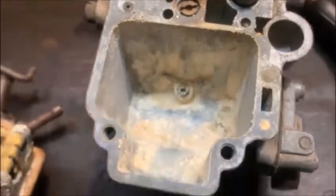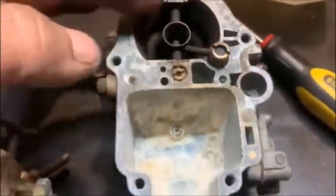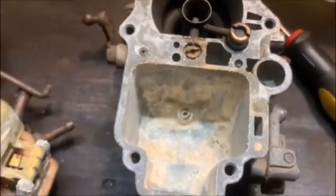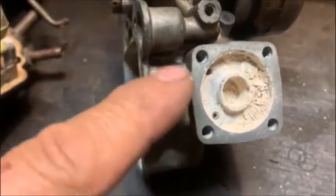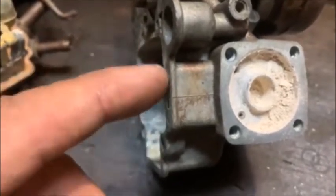That's what the inside looks like. These only have one main jet, one air jet, and one pump jet. I'm going to put this in the mild acid to clean it up and take it apart altogether. It's pretty complete - there's a float and everything, though it's in quite a sad state - and there's an accelerator pump. We'll get it clean.